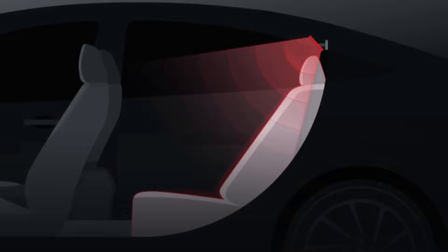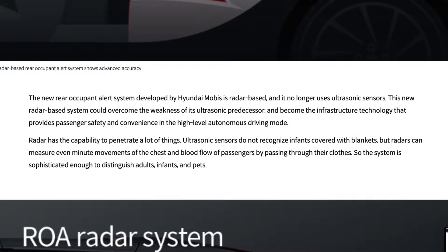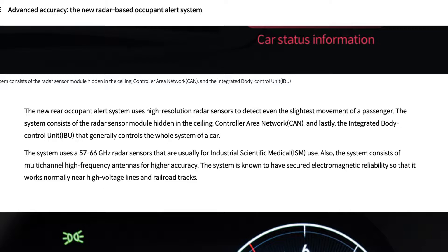The last version that Hyundai, Kia, and Genesis has recently introduced is a radar-based system, currently only in the GV70 but likely to expand to other models soon. This is an improved version over the ultrasonic sensors that can detect more still objects and very minute movement inside the vehicle — so if someone is sleeping and only breathing, this system can pick up that very minute movement and still set the alarm off.